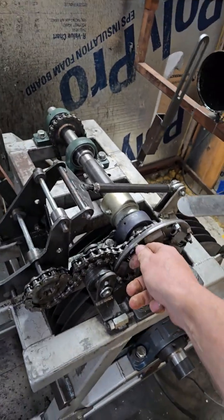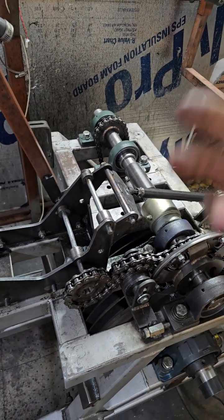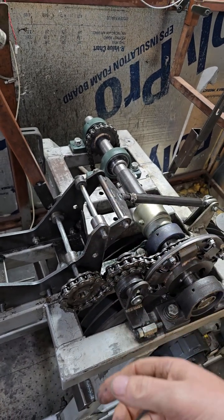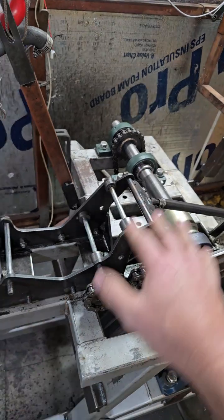So now what I can do is I'll make a pass, and if I see the motor starting to do a little bit of lunging, then I'll go through and I'll change things. A lot of times it's the timing curve. Sometimes it can be the pipe, where the pipe doesn't match with the port work, or the pipe just doesn't match with the whole setup.